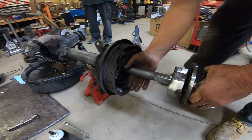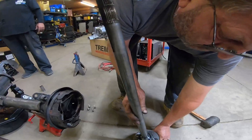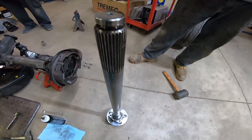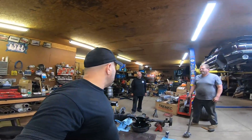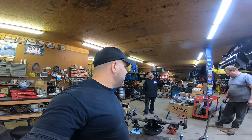So we're pulling out the other C-clip axle, and the one thing I want to look for is to make sure these axles aren't bent, especially this one. Make sure they're not damaged. They've been through a lot of war with us, but the splines look pretty straight. Running a spool in the street — not a problem. We've actually blown apart an Eaton diff here on the channel making about 750, 800. It just didn't like it. That's why we went to the spool at that point.